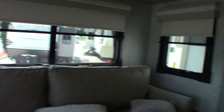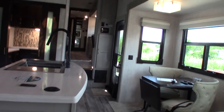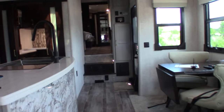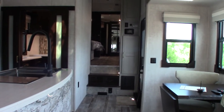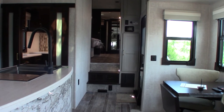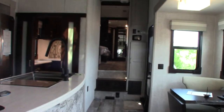First, thank you for purchasing your trailer here at National RV Detroit. Second, please remember to inspect your roof and all the seals on the trailer — mainly the roof seals, roof sealant, and vent covers — on a regular basis. Do that and you'll never have an issue with water damage. Inspect it regularly and odds are you won't have to do anything for years and years, but that's why you inspect it — you just want to make sure everything is good.